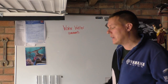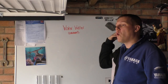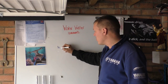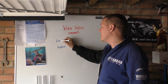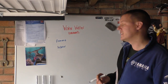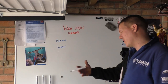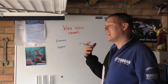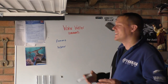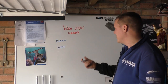And it's physics. People say, how do you know, Matt? You haven't done all the tests. I know, because it's physics. It's chemistry. It's science. It can't possibly, unless Evans was ammonia. Let's just say this: you have water, which is the best, and then you have ammonia. That's it as far as liquids that you could get away with putting in your engine. Mercury would work even better. The problem with mercury is it's heavy, it's toxic, and it costs a fortune. And there'll be other problems, like the solder or the brazing in your radiator, which would probably dissolve, because mercury does dissolve quite a few metals. It's weird.